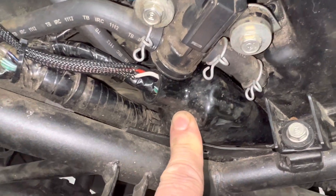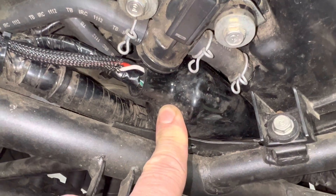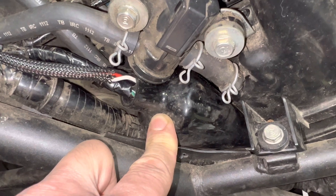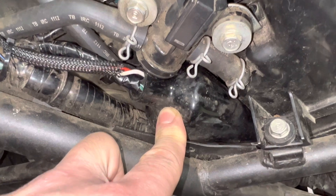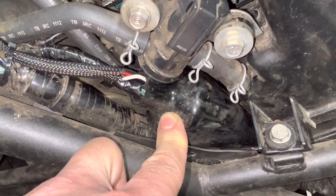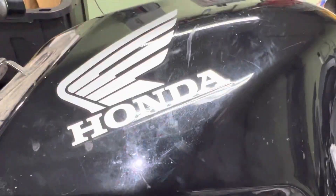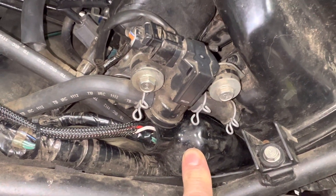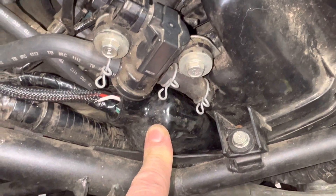This connector — if it's disconnected, the speedometer stops working. It is the correct connector. Your device as you supplied it, and your description, is wrong — it does not have the right connector on it. That is for a different model of Honda or something else. The one that I sent you pictures of is the correct one. It is in here, under the fuel tank. It matches the schematics. It is the speed sensor, and it's been verified with the meter.